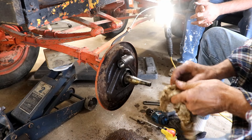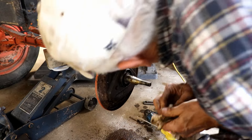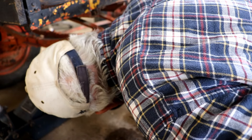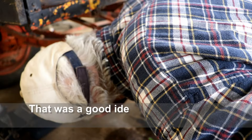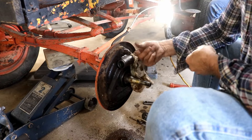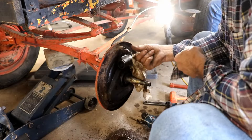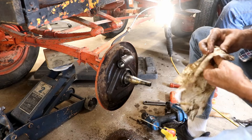I was wondering if it's worth risking putting air in to find out. Well, press it lightly. I'm pretty sure we're going to see fluid come out — tell me when you see it. I see a light drip coming down, but I'm pushing hard! Do it again. Lots of it came out. That's probably good — I think it blew out rust and all kinds of junk. It broke something loose and all of a sudden just gave. It was probably worth doing. As long as we know we got fluid coming through, it felt like I was shooting a spitball out of a straw.